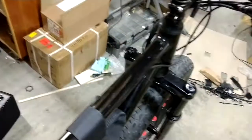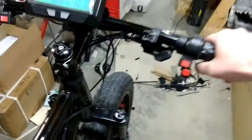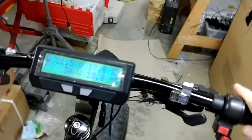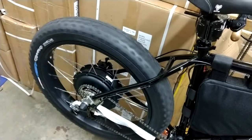The electric brake lever activates the regen braking. We'll give a little demo here starting out in low power mode — unloaded that's a maximum speed of 12 miles per hour. Bumping up to the middle takes you up to almost 18 miles per hour, and bumping up even more gets you up into the close to 24 mile per hour range. As you pull the brake lever slightly, the motor brakes and feeds energy back into the battery.